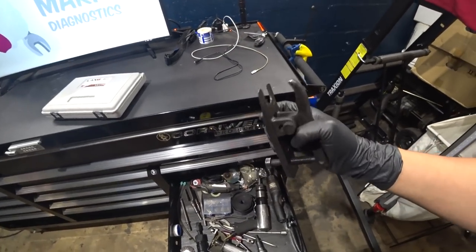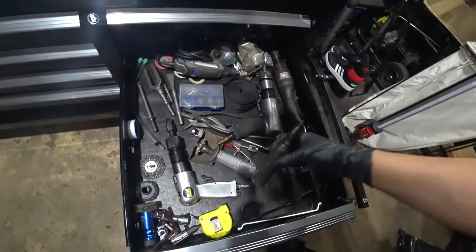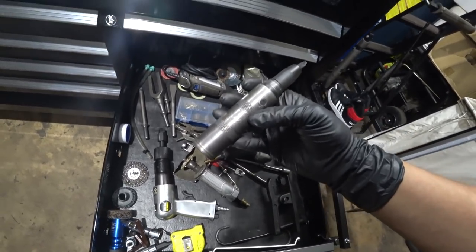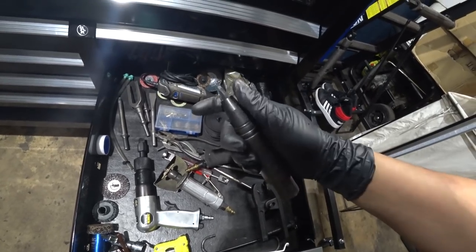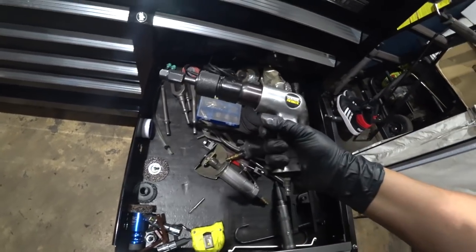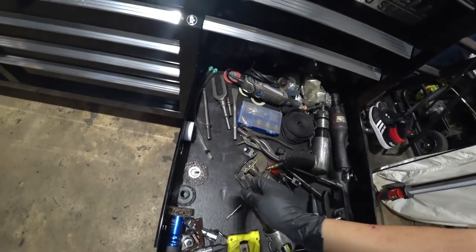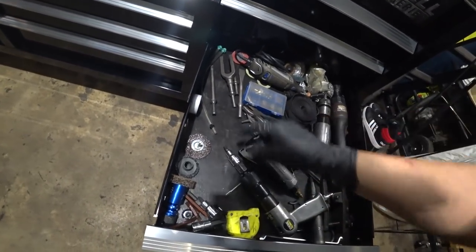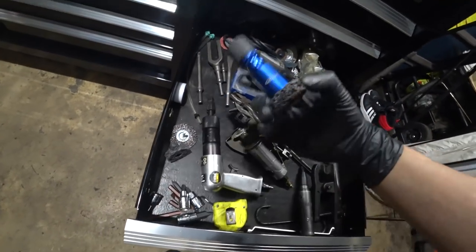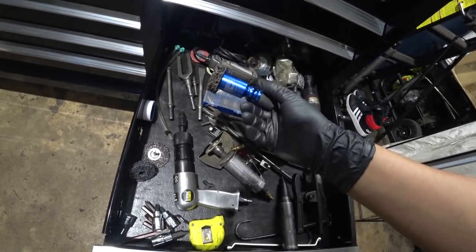One of Harbor Freight's best kept secrets: this outer tie rod remover and ball joint remover. I think I got it for like 20 bucks — doesn't even break a sweat. For those Honda and certain other vehicles with rotor assembly screws, there it is. Another option is the air hammer with a Mayhew bit — put a Phillips at the end, hammer as you twist and remove. Last resort though. Got a hub cleaner — hook it up to a half-inch drive and clean out those hubs before putting on new rotors.